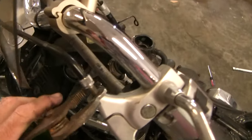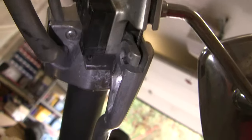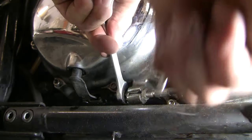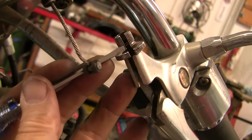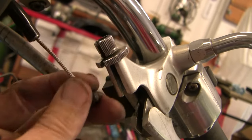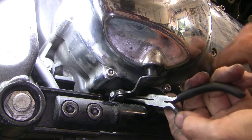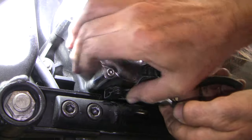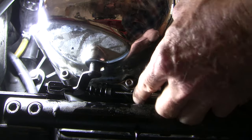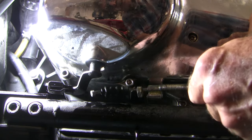There are three points of adjustment for the clutch. The first is up here at the handles — screw this all the way in to give yourself as much room as you can. There's a little tab there; use needle nose pliers to flick it out. Make sure the slot is lined up with this slot, which is lined up with this slot, and once you have enough free play you can slide this out of that little hole. The secret is to get lots of room, then twist it sideways and slide it out. Once the clutch cable is completely free, unscrew this nut to allow this part to slide back and out.